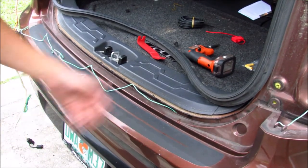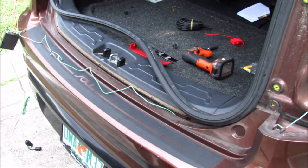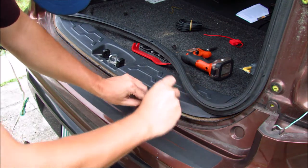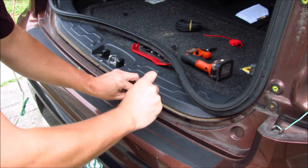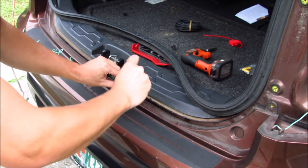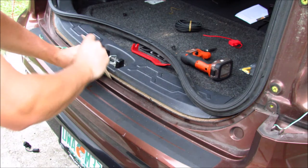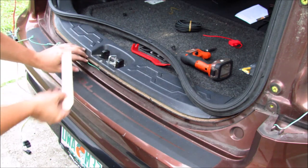To make your life a little bit easier, I'd recommend pulling off this rubber gasket — it goes all the way around the base of the trunk and keeps your water seal in the back. You don't want to rip it; just pull it away from its flanged receiver. You'll notice the green wire is tucked close up against there. I'm using a painter's stirrer, like a popsicle stick — anything soft. I didn't want to use a flathead screwdriver because it's very thin cable sheathing, and you really don't want to puncture through anything, especially with electronics. So I'm just pushing it down underneath this lip, taking my time. If you get stressed out, you're going to break something, so don't stress about it.